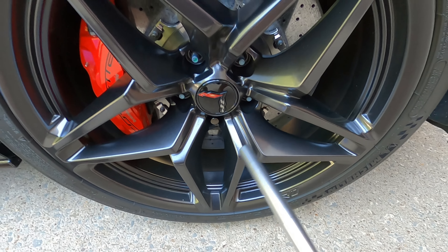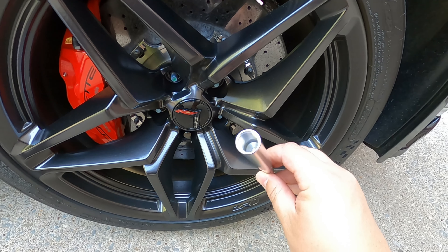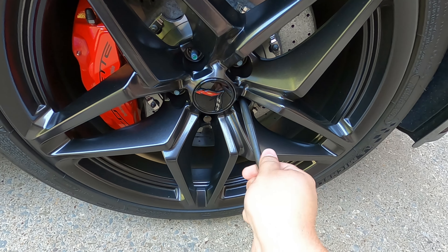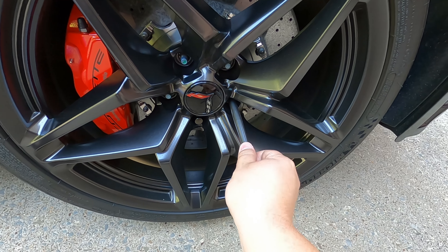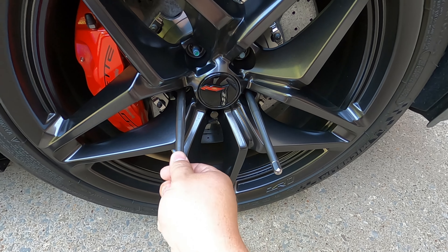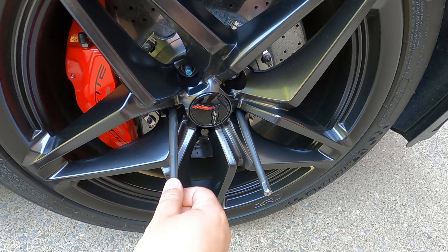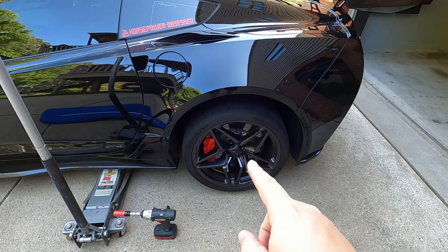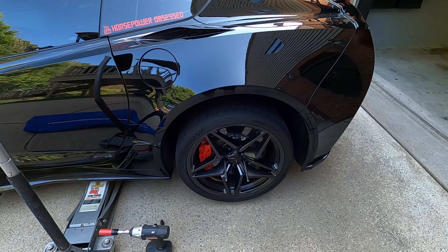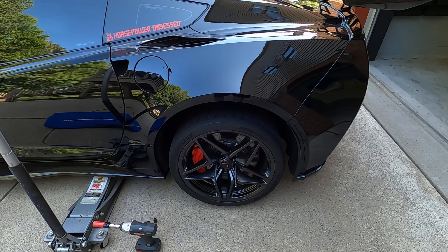We have all the lug nuts minus one off so the wheel will kind of sit in place. What we're going to do is take this dowel, which is obviously threaded on the end, and thread it right onto one of the lug studs. That's pretty much it. We'll do this with one of the other ones too, just to make sure that the wheel stays nice and straight as we're pulling it out. So the second one, same kind of thing — we'll go on this side, tighten it down, take off that last lug nut, and pull the wheel off. I will link these in the description down below. You are actually going to be able to buy these on my website. They ultimately come from ACS Composite.